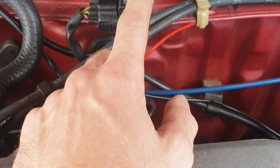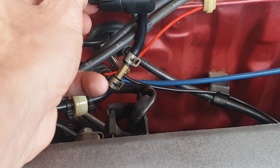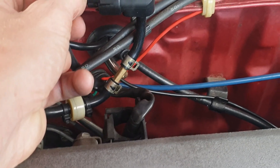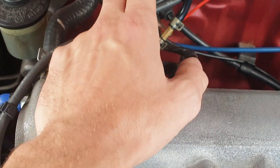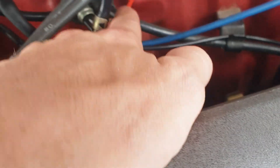Back in — it's pretty straightforward on how it's actually done. Sorry it's a bit overcast, bloody bright for some reason. You've got your stock MAP sensor here, you've got your three wires: your ground, your 5 volt, and your PIM which is the actual signal for the vacuum coming from the manifold. I've tapped into this wire but it runs all the way back through here into the ECU — I've found it at the ECU end, it's just a lot easier to do it that way. You can go online, search up all your pinouts for your ECU of your choice and it will lay it all out for you.